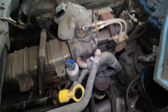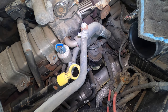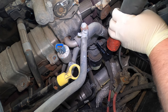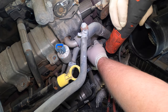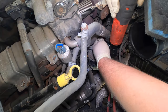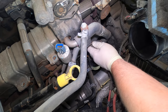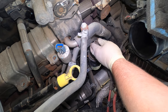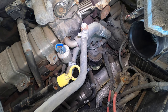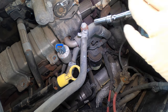Next I'm going to take this little shield off right here so I can get to the clamp on the cooler. There's just two little 8mm bolts - the shield's not going to come all the way off, I just need to move it and bend it out of the way. I'm going to bend it gently - we're not trying to break it. Sometimes if you take the nut off it can rip or tear the shield, so try not to touch the shield.